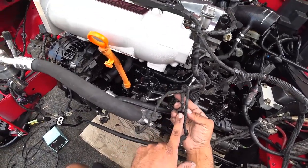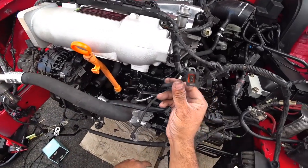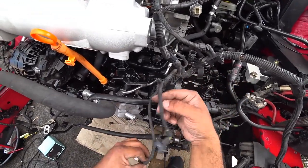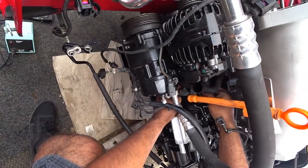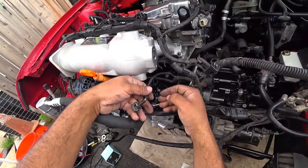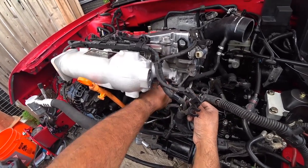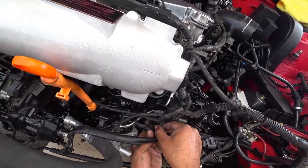This one with a single wire is your oil pressure sensor. And this is your crank sensor. This is actually part of the N249 and N75 setup that sits under the factory — so this actually has no more use for you. This just stays on its own, not plugged in. We're going to run the crank sensor down here and plug it in. You have two knock sensors: one knock sensor here, and the second one is actually on your fuel injector harness — I'll show you that when I get to that point. That one's in kind of a funky spot.